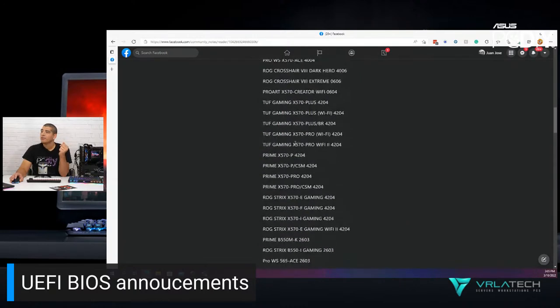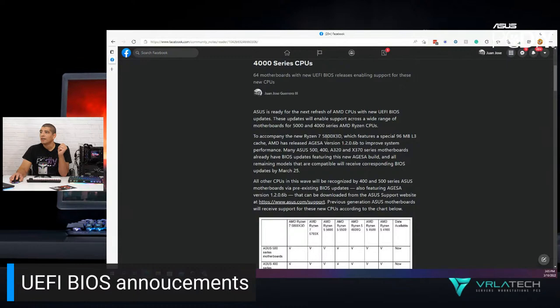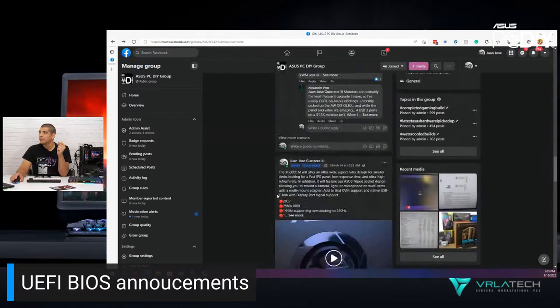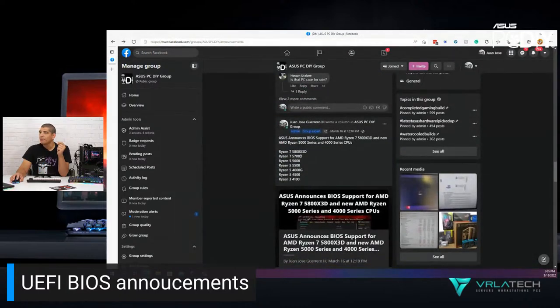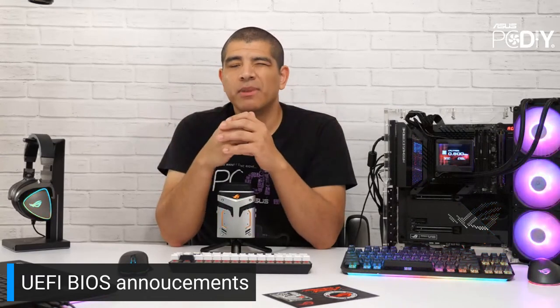For boards like the X370, this will generally apply to users interested in the newer range of CPUs from AMD — for example, the 5800 X3D — along with quite a number of new CPUs being issued by AMD. The new CPUs in this lineup include the 5700X, 5600, 5500, 4600G, 4500, and 4100. If your system is already running stable and reliable, there's no reason to update the UEFI arbitrarily.